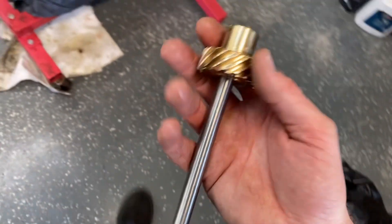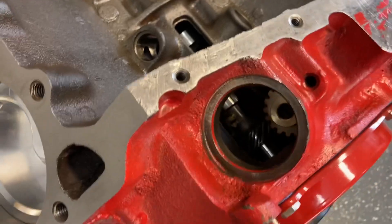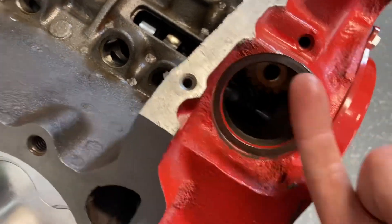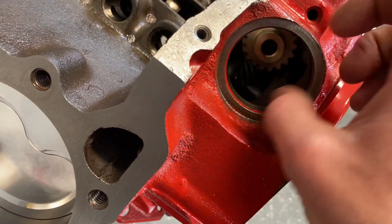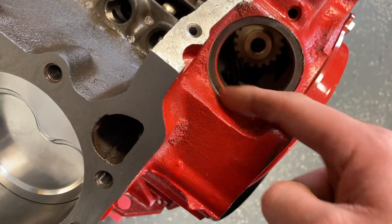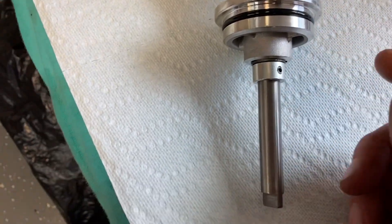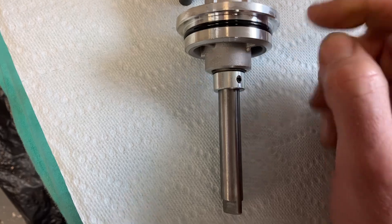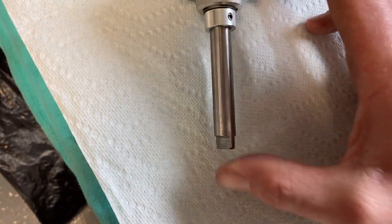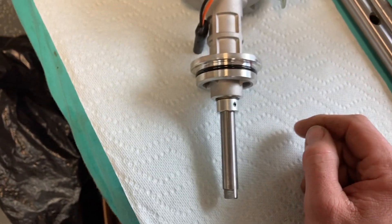So I want to show you the difference between these two. Here's our 440 shaft — I'll drop it back in and drop our distributor in. When you go to put a distributor in, this area inside of here needs to be nice and clean — I've scraped all the paint out and wiped it out. I think that's actually more important than this section, which I did scrape all the paint out of too. They do give you a little paper gasket in the kits that seals one side, but the majority of the sealing is with this beautiful O-ring right here. I've forgotten to put the little gasket in before and it's just fine. If you want a little more engagement on your shaft down in the other shaft, leave the gasket out — it shouldn't leak. That O-ring is very powerful and does a great job.